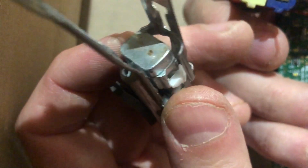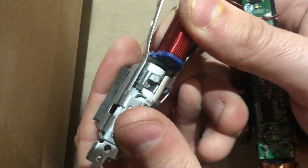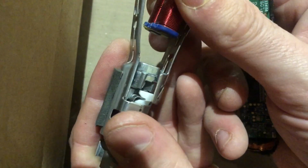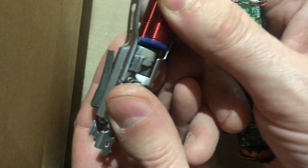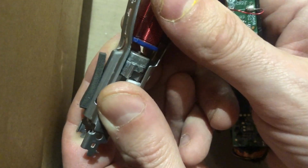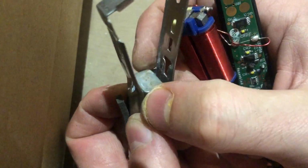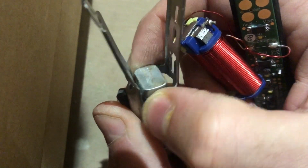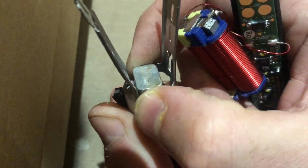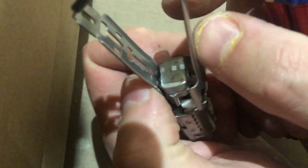And there, I think what is going on here is this bracket here is designed to hold this at like a millimetre gap or some kind of gap, so it's not touching this thing, but the EMF causes this little magnet to rotate like this. It's difficult to show you, but like that. I don't think it goes side to side, I think it goes like that. And that's what causes this sonic toothbrushing.